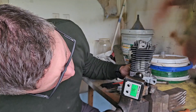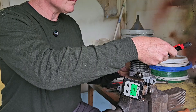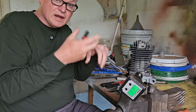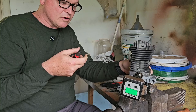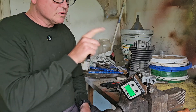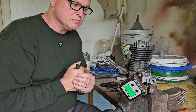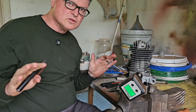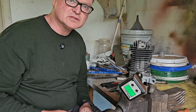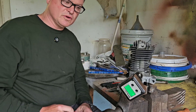Right there for the exhaust — we're about 96 degrees on the exhaust. About 96, something like that. It's hard to hold it steady; it keeps wanting to rotate on me. I've never seen something that bad. We got 78 on the intake, which is about spot on perfect for just the firewood build. 96 on the exhaust, which is way too high, especially whenever you've only got a squish reading of 63 thousandths of an inch, so that means we're not going to have very good compression at all.